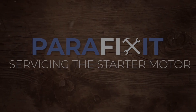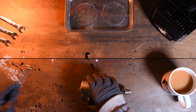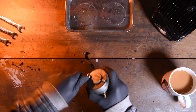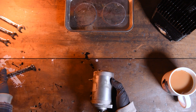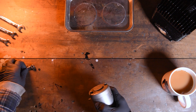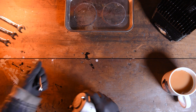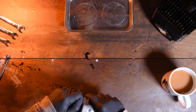Hey guys, welcome back to The Shed. This episode is for you lazy folk out there who don't pull start your paramotor. The first thing you're going to want to do is undo the two bolts that hold the back cap in. Mine are a couple of 8mms and these are long screws that run the full length of this starter motor. The reason I'm servicing my starter motor is mainly because it was a little bit sluggish starting when I first got the paramotor.